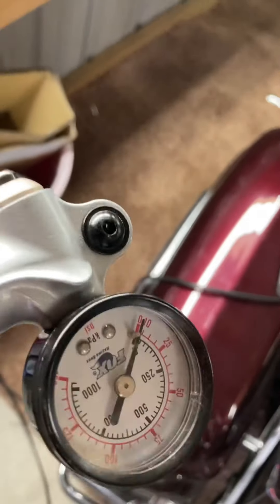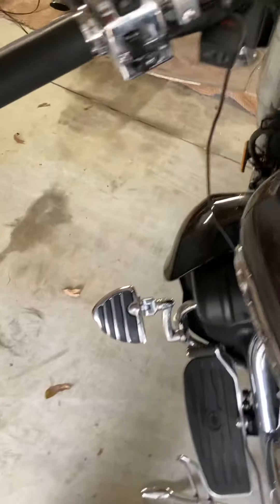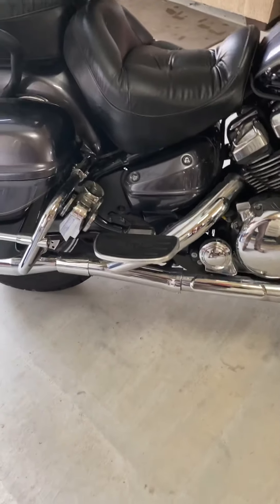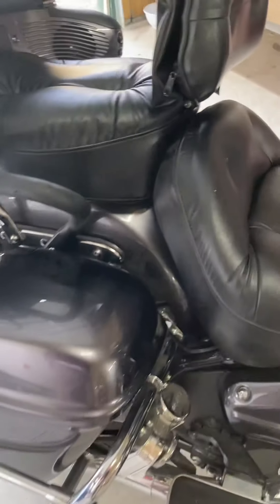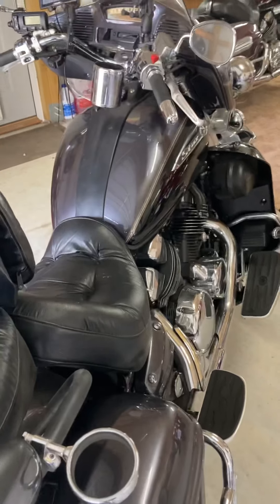Get yourself one of these — this brand here is Fox, a little hand pump. I bought it off eBay and got a good price on it. That's how you air up your shocks. If you look at your service manual it tells you the front and rear pressure. Hopefully that'll eliminate the squeak I noticed in the shock today. There's no evidence of my shock leaking — I don't think it's a leaking problem at all. We'll see and I'll report back. Hopefully this is helpful — enjoy!